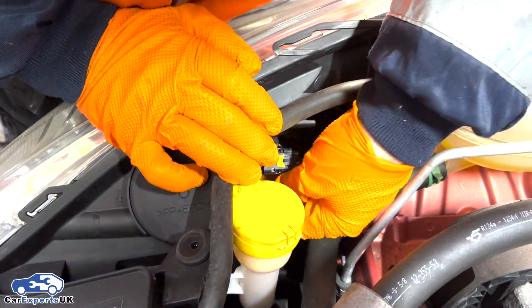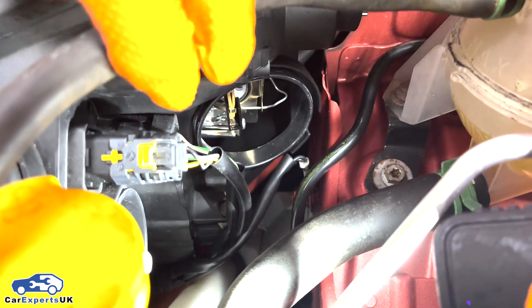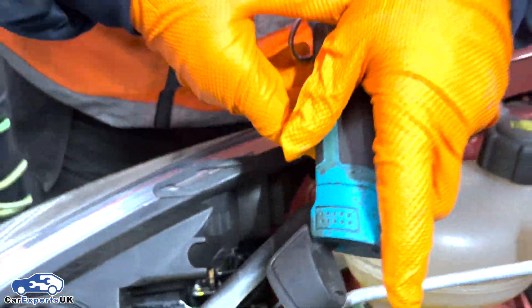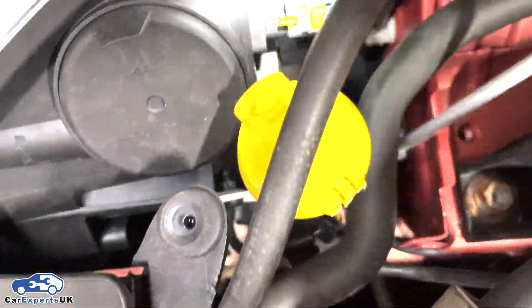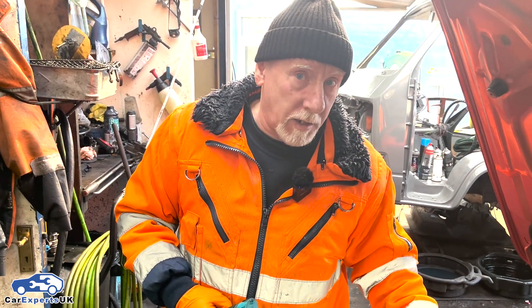This is the headlight — take this cover off. I don't know whether you can see it but it's in the back there. There's two pins on that bulb — that's a H7 with a two pin plug. I'm going to see if I can get it off. That plug's off. I've got to try and get the bulb. What I would generally do is get a small mirror and it'll help you look into the back of the headlights because you can't physically get your head around to see what they look like.